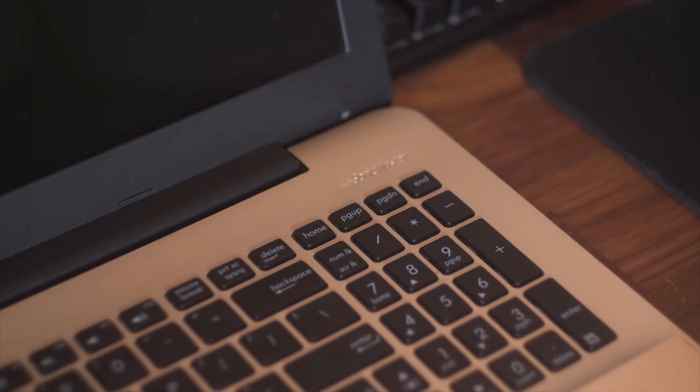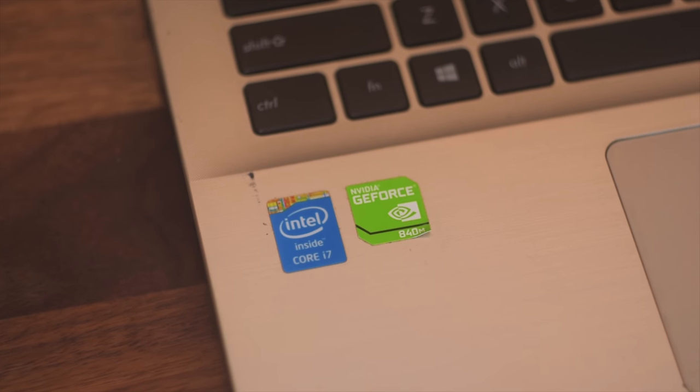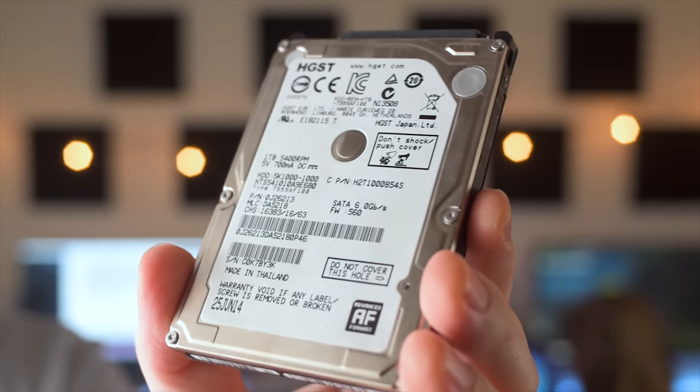It's not that terrible a laptop — it's got an i7 in it and a decent amount of RAM, which is also one of the hints people give for making your laptop better. But the biggest bottleneck in these laptops is always the mechanical drive, because normal hard drives are bad enough as it is, but in a laptop they're even worse because they spin much slower.